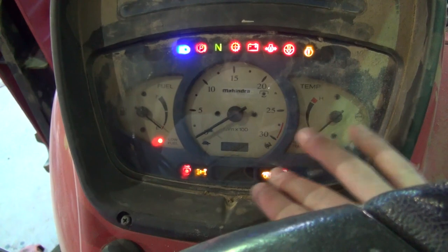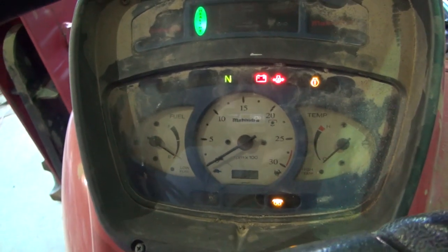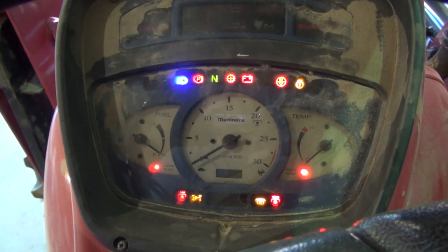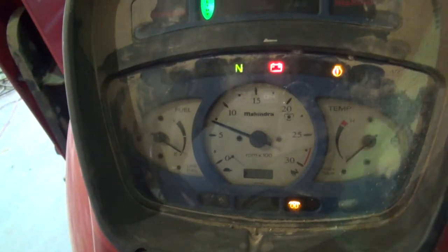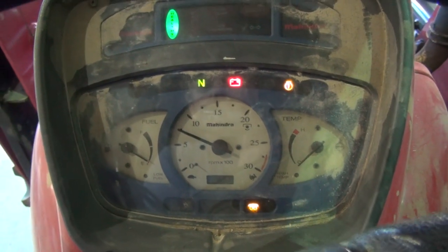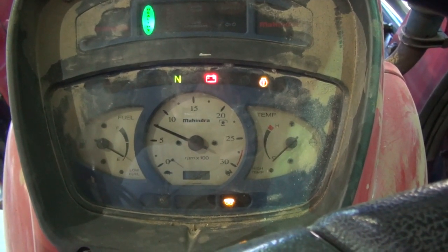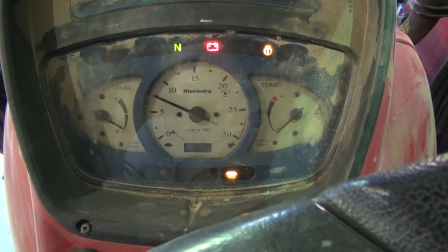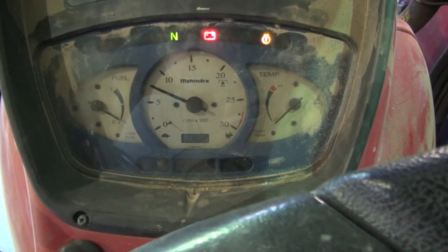You see the little glow plug light there — it's actually a grid heater on these that don't have glow plugs. This battery light will probably stay on when it first starts. That's about where it's setting at — it'll come up just a little bit once the grid heater goes off and the load on the alternator lightens up. It'll come up just above 750, probably about 760. Beforehand it was idling about 900 RPM, which is a little bit too high for my liking.